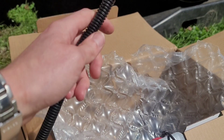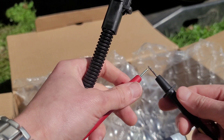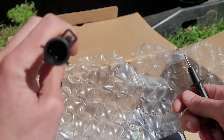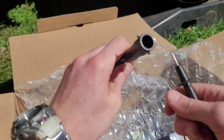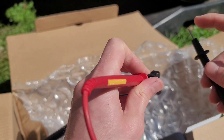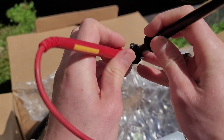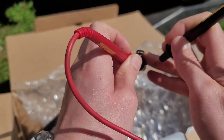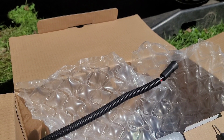Okay, that's a little better — now I can use both hands to test. As I was saying, continuity between these two circuits. If you look down inside here, there are four pins inside. Basically, you want continuity between the top left and the bottom right — and on this new pump I have it — and then continuity between the bottom left and top right — and I have it. So this brand new pump tests good, as it should. Let's go look at the old one.